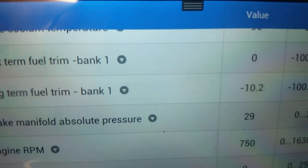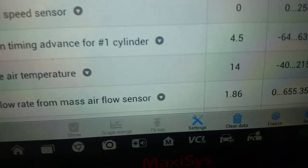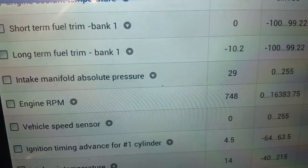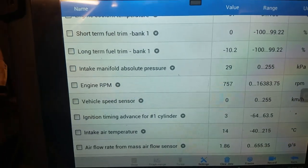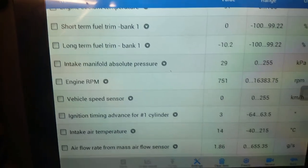The reason why we're interested in this is because our fuel trims are always negative. So negative fuel trims and it's not reading exceptionally high, so it's very subtle. There's no real drivability issues and it's not flagging an engine management light, so we do suspect the MAF. Sometimes the short-term fuel trim goes as much as minus 10.